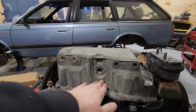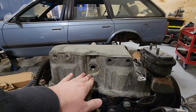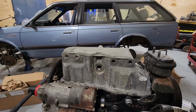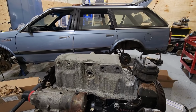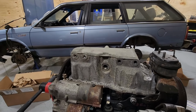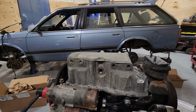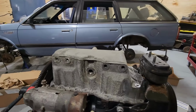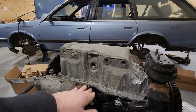So your fluid level should be somewhere around here, probably, I'm guessing. If it's going this low, it's going to be setting off a low oil light. So ideally, you want your turbo drain to not have any restriction at all and having to fight against that fluid that's already there. Seems to me like that could be a restriction. So I think ideally, you want the oil return line to be higher than that.